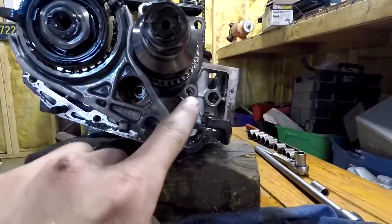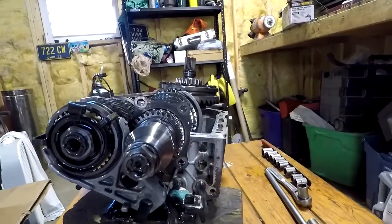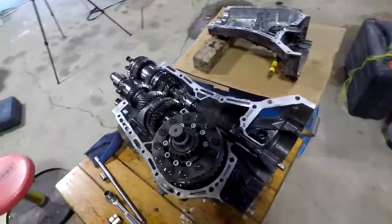Once you are able to trust yourself with either pressing or hitting, something has to be backed up against something because bearings cannot handle that impact. Once you press them out, you can take off all the stuff off the front of your transmission. I took all the bolts out of the case - there are two bolts here and both there - which holds the cases together. I was having a problem getting these apart, so instead of beating on stuff I was tapping with wood, then tried a piece of aluminum with a hammer so the steel wasn't mushing the aluminum. That wasn't working and I would not do that again.